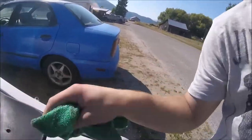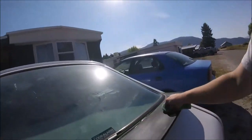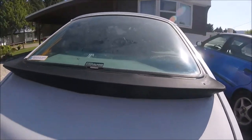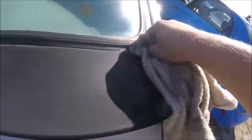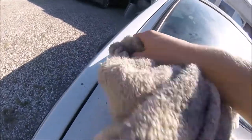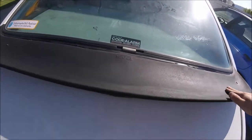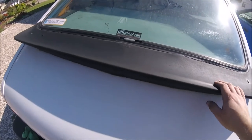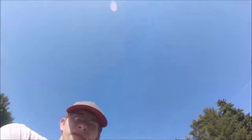Once you've gone over the whole thing, let it sit — since it's in direct sunlight, I won't let it sit too long, maybe five to ten seconds. Then take your junk towel and buff it off in circles or just randomly. And there you have it — that's how to wet sand and restore smoothness on the rear spoiler of your C900. Hope you enjoyed and found it helpful. Don't forget to hit that like button or the subscribe button. Have a good day!